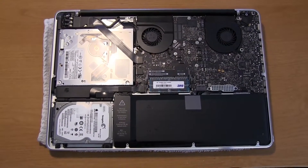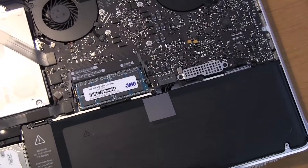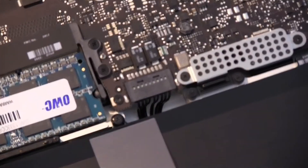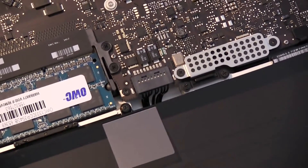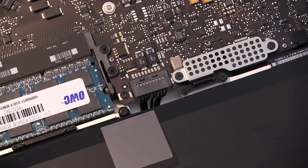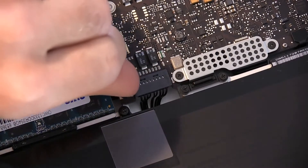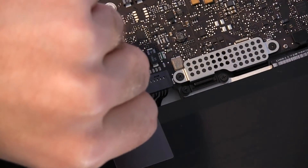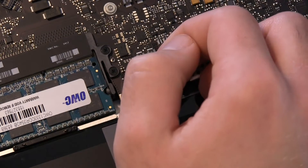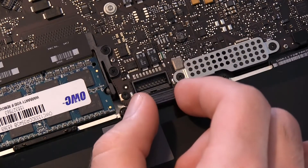What you want to do is look for that little connector right there — it's right next to the memory. I've upgraded to OWC Other World Computing memory, a great site to get your Mac memory from. I'm going to zoom in on that connector. You just pry it up a little bit with your fingernail from this side, and there we go — it disconnects. There's the pin connector. You're now ready to remove the hard drive.